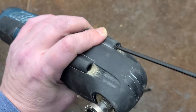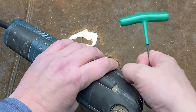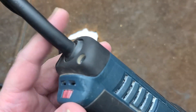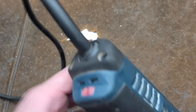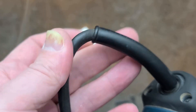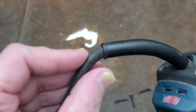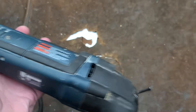The rest of the build quality is actually pretty good on these — good motor, good variable speed, long-lasting brushes. They have this weird cord thing which doesn't really do any good. All it does is offset some external fatigue on the cord to the internals of the body, making it a more expensive tool with more complex over-moldings. That extra bit of flex makes virtually no difference because almost all power cords fail right at the edge of the strain relief. The strain relief needs to be really progressive — really thick, tapering thinner and thinner to almost nothing — to prevent the cord from having a sharp bend. That's the root cause of cord failures.